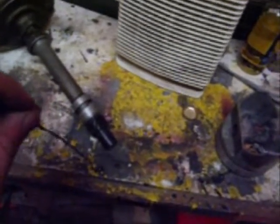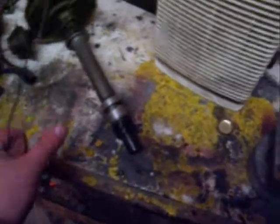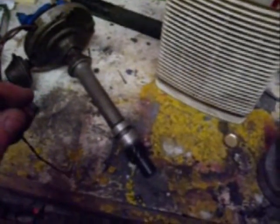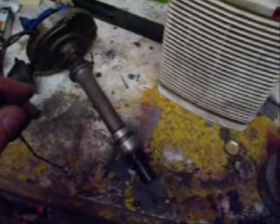After I put my finger over the hole and it starts blowing out air on the compression stroke, I stick this wire down in the spark plug hole. As the piston comes up, this moves up. When the piston starts going back down, this goes down. If I'm dead set on getting it exactly at top dead center, I'll crank it back until the wire is up and doesn't go down either way — that's top dead center.